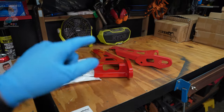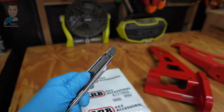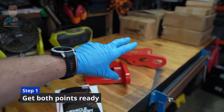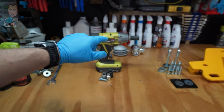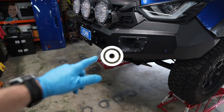So ultimately that's why we've gone with the ARBs. Let's rip open the bag, check out all the hardware, and get these guys installed on the front of the D-Max. Our first step is to grab all our nuts and bolts, both of the recovery points, your assortment of sockets, a ratchet, as well as a rattle gun if you've got one, and get everything underneath so we can get everything in position to bolt it all up.